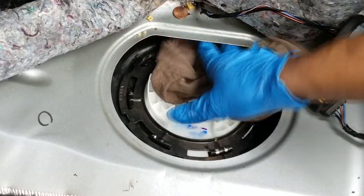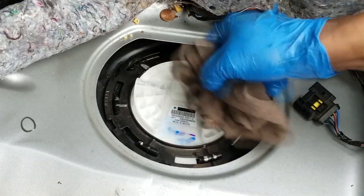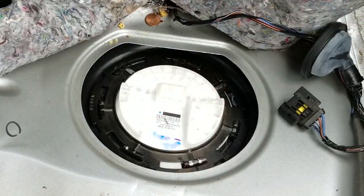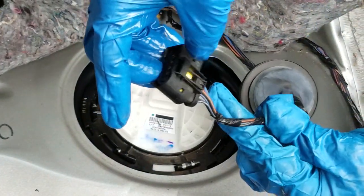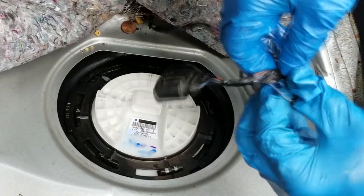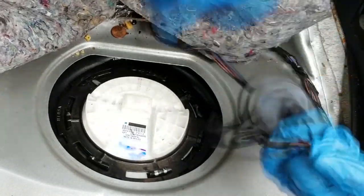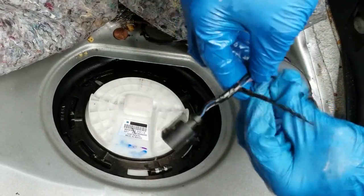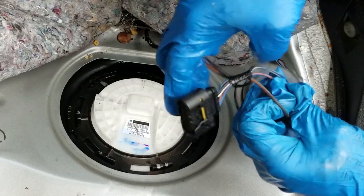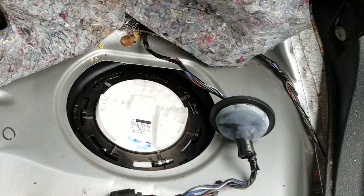That should about do it. Keep in mind, you're still not ready to crank and go, because you will have to rewire the system. I'm going to make that part three — that's ten minutes in itself explaining. What I'm going to do for now, since I have to replace the connector anyway, is rig this temporarily so I have power supply and ground in the right spots just to drive it into the shop. I don't want to push it in. All I'm concerned with right now is power and ground — the other three small wires going to the sending unit, I don't care. I need to put these in their right spots, so I basically need the wiring diagram.